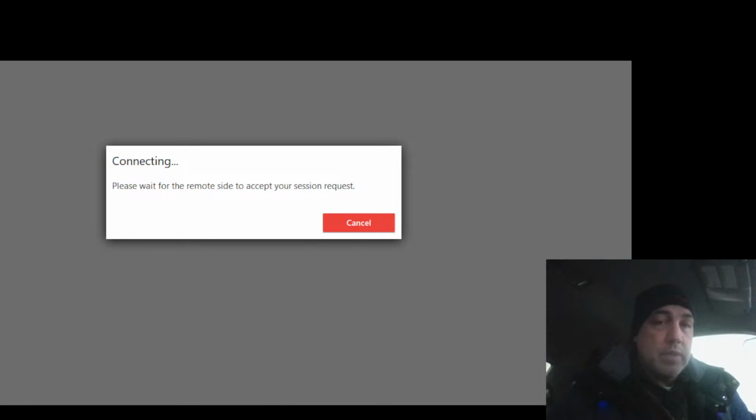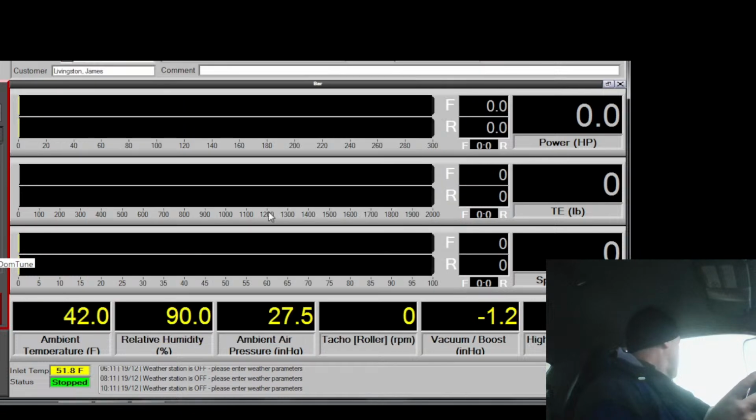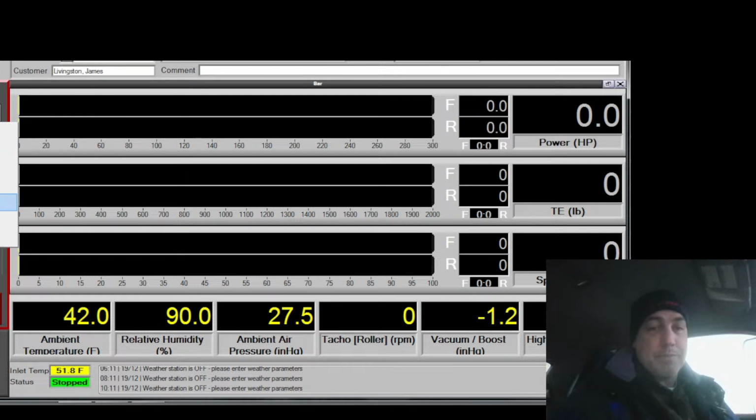IAG did something really cool. They made rails with dampers in them. It was a great step, but it was discovered after a little while that the dampers created fueling issues. Which obviously is not why you put them in there. You put them in there to fix fuel issues. So unfortunately, that means that the cars don't idle quite as well or have low speed characteristics quite as well as they would with dampers in them. But it's even better that we don't have to deal with the car going lean in boost.